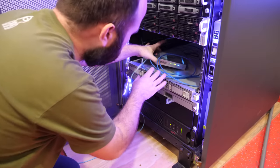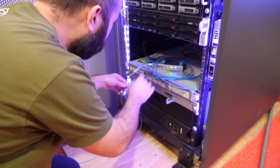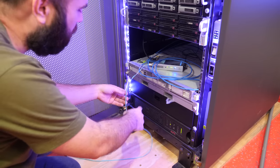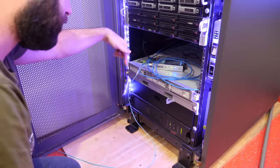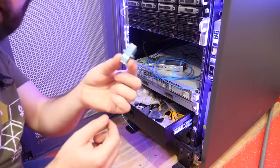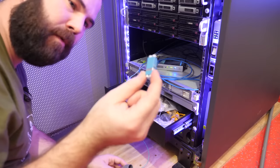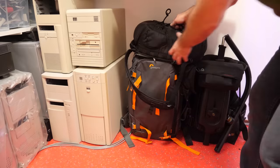So here under in my rack I have my MikroTik switch for my 10 gig network, and this fiber optic cable goes to my other room, to my workstation, but it's quite short, so I'm going to extend it with a longer cable so it can go up my rack and down into it. And to do that I need a coupler, and here I have a fiber coupler, but this unit is a bit too big because of these side pieces, so I made this slimmed down version so I can put it in this pipe. So let's make some room,